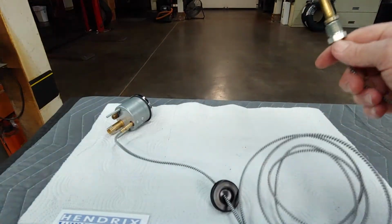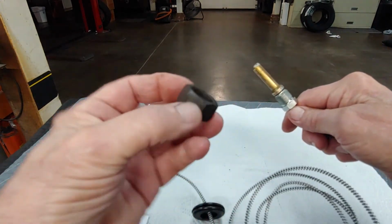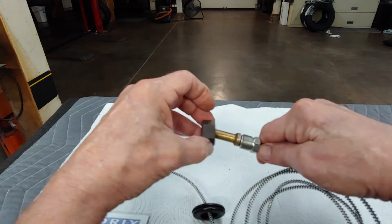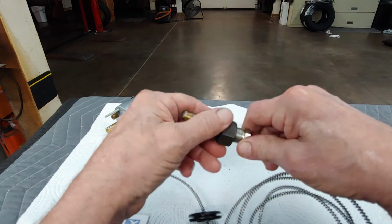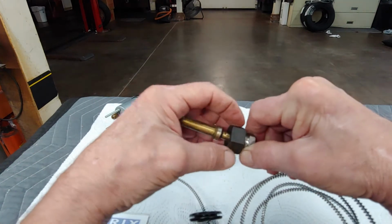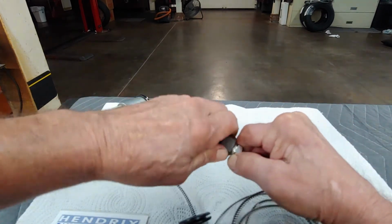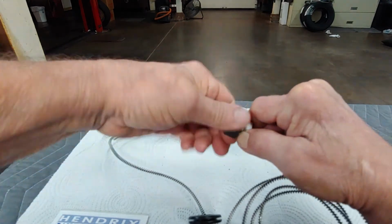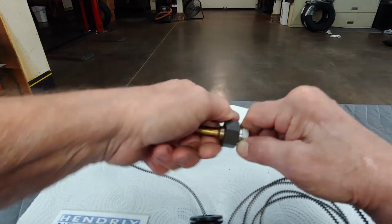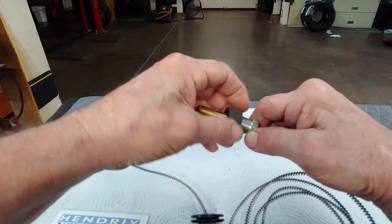So you're gonna have to check this with a chaser, a 5/8 NF chaser thread. You can just put that on there and clean the threads up, because you don't want to get that far and then you can't get this to go in. See, it's hanging up right there. So you just got to clean that. Make sure it's got good threads, probably Chinese threads. So the first one, this one wasn't too bad, but the first one, it wouldn't go in at all.